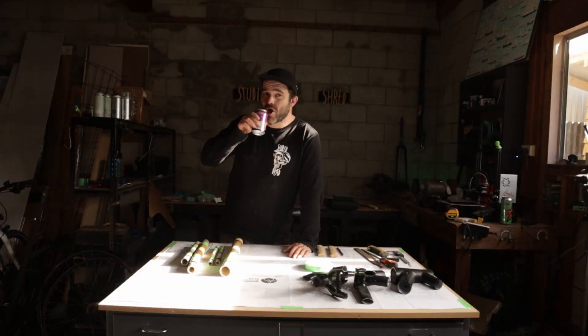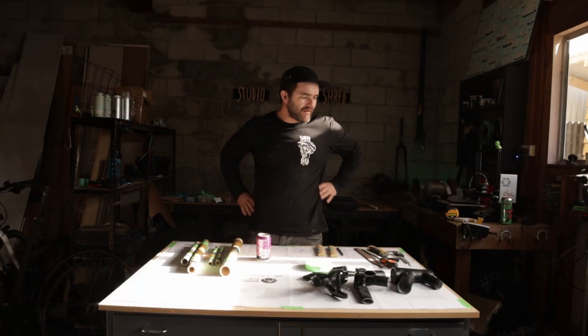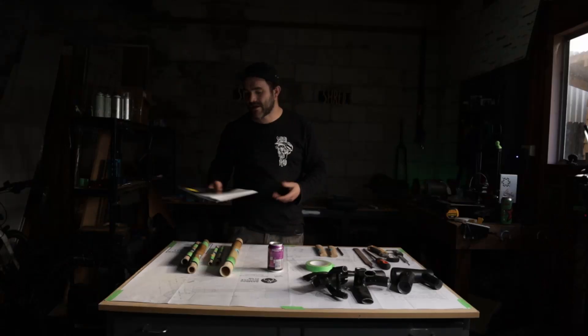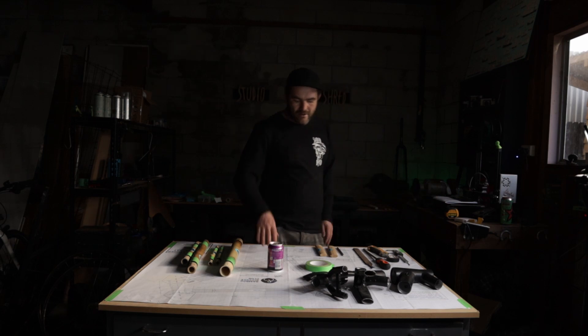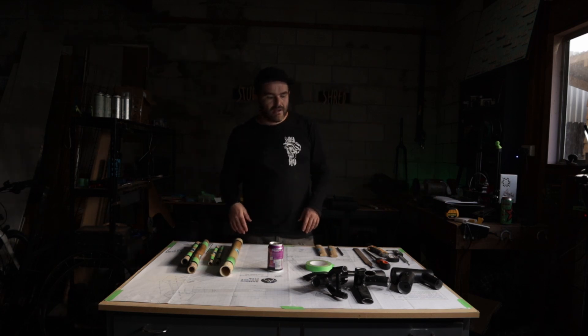I found that the calipers have been really helpful here. When I'm shaping, I'm just trying to get everything close to the final diameter and nicely round. I'll work that with the anti-cutter first, then sand it so it's perfectly round. I'd save the seat stays to either second last or last. It was probably three or four hours total — the first tube took me about 40 minutes and the last one probably four. Next step is to do a test fit, a dry fit. I'll do that now, and then we're going to assemble the jig. Hopefully everything goes nice and smoothly.